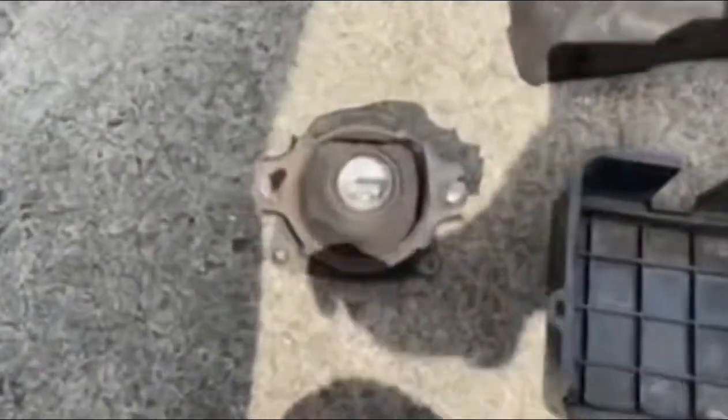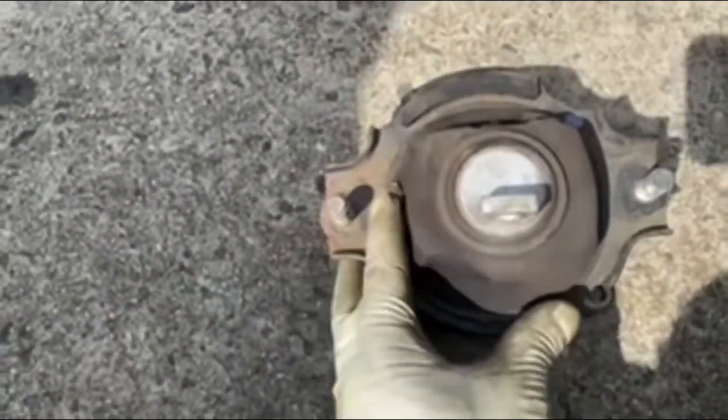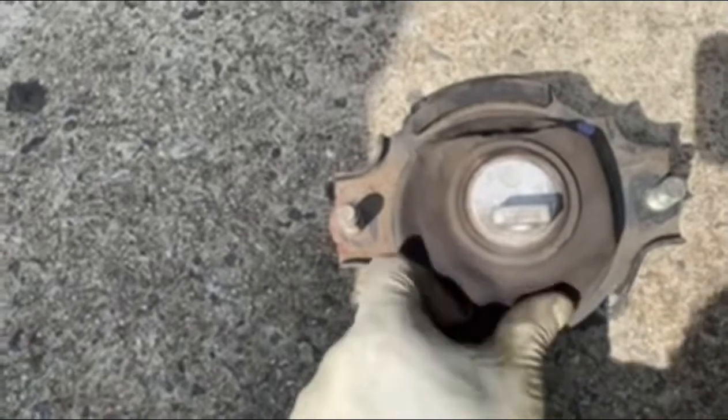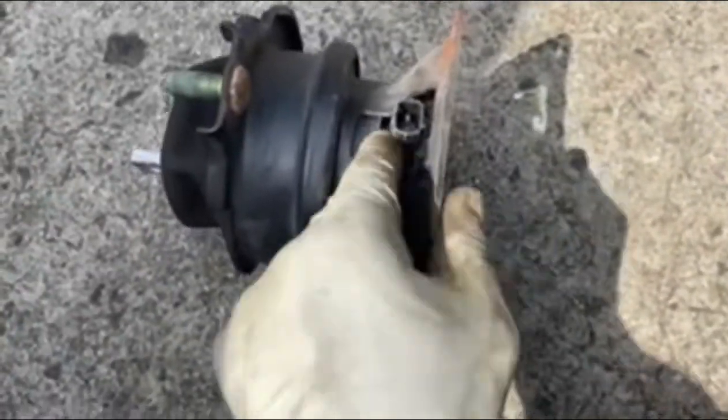There's a little clipper down here, up under this little cover — it's a front engine mount. And one thing about this front engine mount: when they go bad, let's look at the old one right here — it's got like a bag effect. The reason why it's real gushy and smushy is there's some gel in there, some hydraulic fluid. And what it is — this is an actuator.